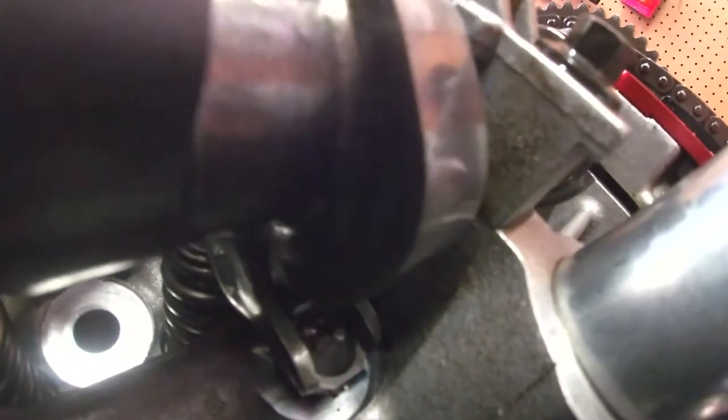It looks like it just barely needs to be clearanced and they over-clearanced it a little bit, probably due to different lift sizes. It does look like it kinda rubs on the way around so I gotta flip it and put the feeler gauge on there, but I checked both sides and the intake and exhaust are not rubbing — that makes me feel a lot better. Alright guys, I hope you enjoyed the video — stay tuned for next week because we should be able to get the heads on and get the engine ready to go back in the car. Make sure you like, comment, subscribe, and let me know what you want to see. We should be getting this car done soon so I can take requests and maybe we can go do some cool stuff with it.